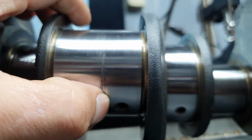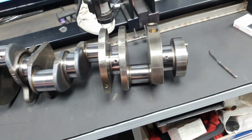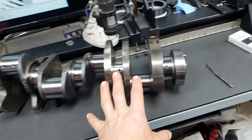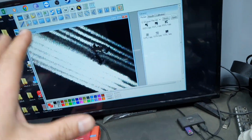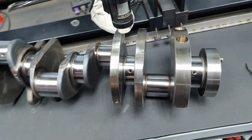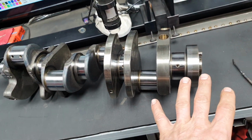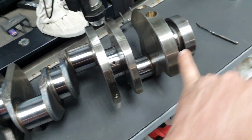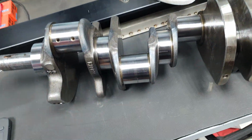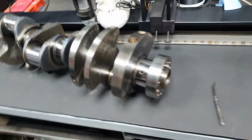And you have also this here. For me, I don't feel comfortable closing an engine with this crankshaft, especially an upgraded engine. I'm not talking about a stock engine. Even for a stock engine, it's not gonna be ideal. So, for me, it's going to be much better if we get a used crankshaft, polished to be nice, without any corrosion or damage from corrosion. But that's me.